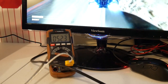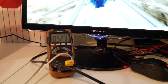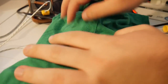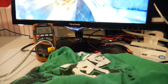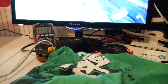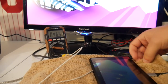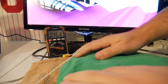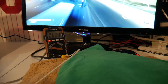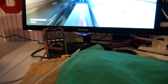While most people would be satisfied knowing the Switch is fine on its back, I wanted to push further and figure out ways to make things harder on the cooling. First, I put a shirt on top of the Switch — maybe someone has a messy room and accidentally leaves their shirt over it. I was able to get temperatures just over 53.5 degrees with Fast RMX. Then I added a towel underneath as well, since some people may lay it on carpet causing insulation. After nearly 30 minutes of constant Fast RMX gameplay, I slowly climbed to just over 60 degrees Celsius.